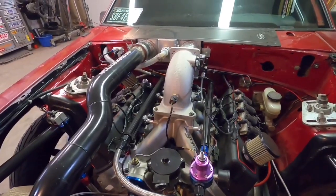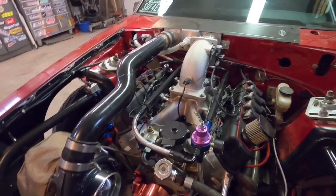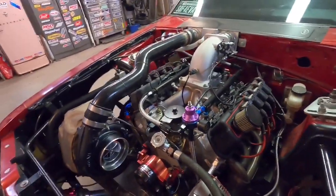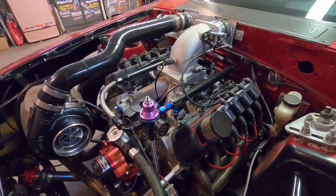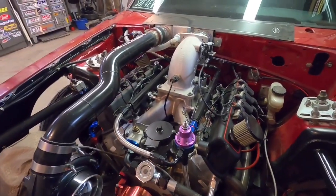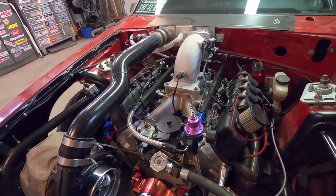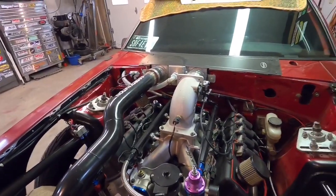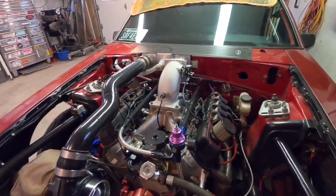If you're new, you might think spraying water into the engine would damage it — but it's not like spraying a garden hose in there. It's a super ultra-fine, high-pressure mist that vaporizes and pulls heat out before it could cause hydrolock. Water-meth does work, though not as well as a really well-engineered intercooler. Like air-to-water, you need methanol, reservoirs, and pumps. The real downfall is if you're tuned for methanol injection as your main cooling source and the pump fails or the system doesn't kick on, your engine is at greatly increased risk of melting down — though the same failure risk applies to an air-to-water pump stopping mid-run.